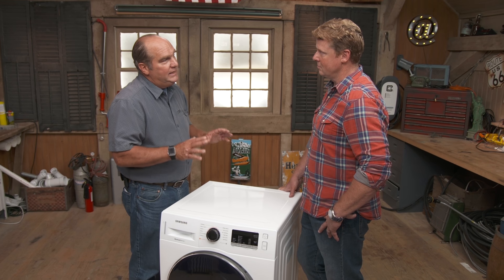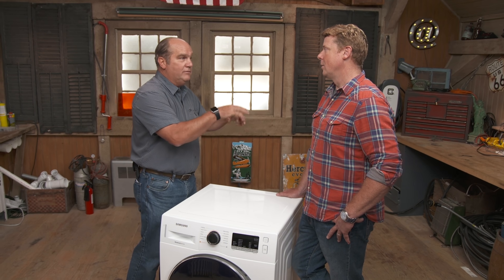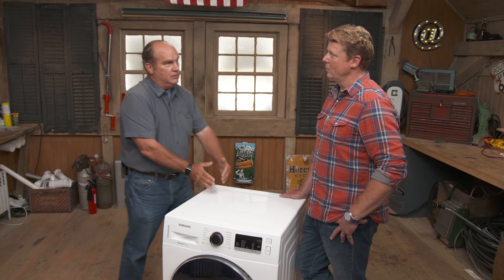This is an electric heat pump dryer. It's the story that we need to learn to move heat, not try to make heat like a conventional electric dryer. Any heat pump has two components — same as an air conditioner, it just depends on which way it's going. It has a really cold coil. In air conditioning mode, warm air inside the building blows across the cold coil — heat has no choice but to go into the cold and be absorbed into the refrigerant. The byproduct of that is always condensation — that's the water that drips out of every air conditioner. Outside, there is a really hot coil to dump the heat to outside. This thing takes these two pieces and brings them together in a heat exchanger at the bottom of the unit.